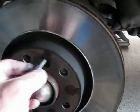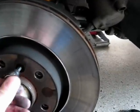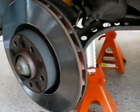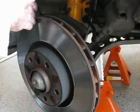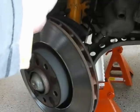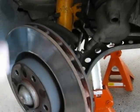To get the rotor off, we need to remove the little capture bolt — it's a 6mm Allen and should come right off. By the way, you might notice I turned the whole assembly: I got in the car, turned the ignition to unlock the wheel, and cranked the wheel a turn or so just to get clearance for those caliper bolts — otherwise the suspension was blocking my air gun.